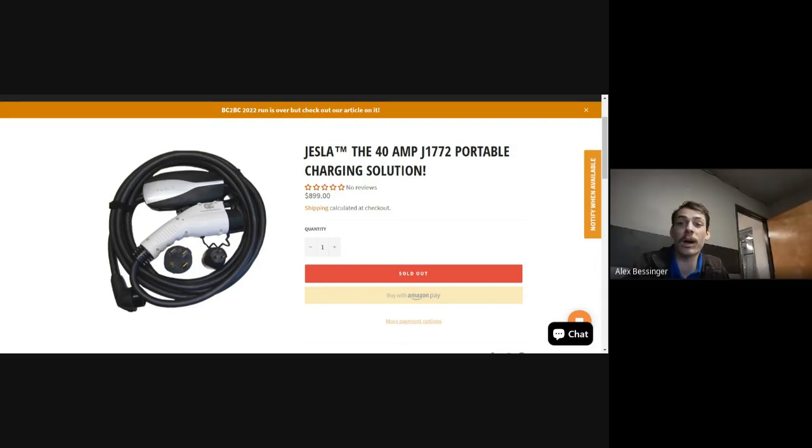Right. So a battery imbalance can be caused by a bad cell. And a lot of the time on these older cars, the culprit is just one cell or a small number of cells that essentially go parasitic. They create a draw on the cells around them and create this imbalance. And the BMS is really sensitive to these kinds of things. If you get an imbalance of more than maybe 10 or 20 millivolts, it's going to start having a problem.